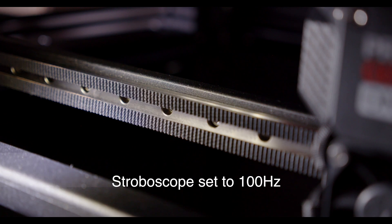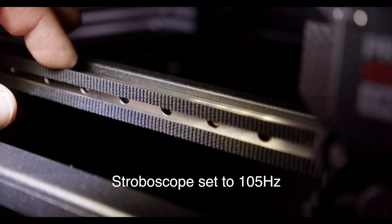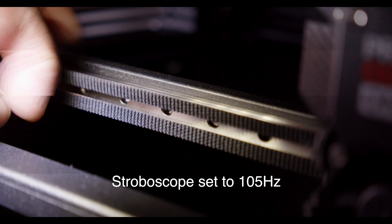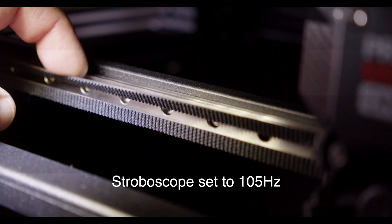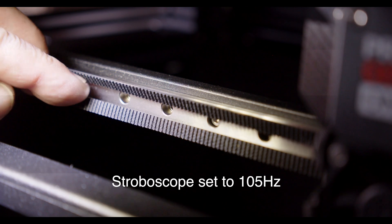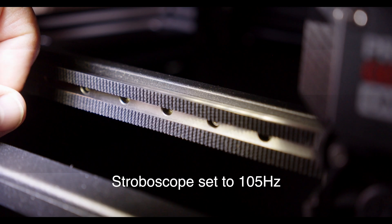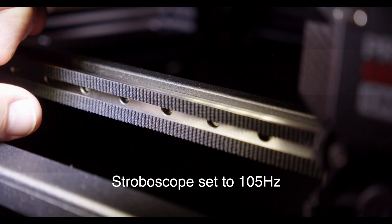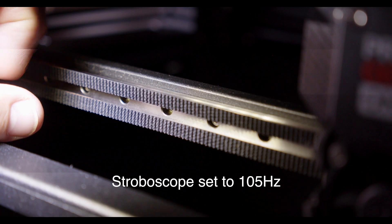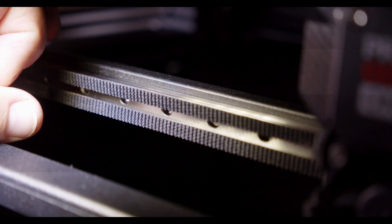So the upper belt is 105 Hz. I'm changing my lamp here to 105. Now it's not going back and forth anymore — it stands still, basically. The lower one, you see how this goes back and forth? So the frequency at 105 is where the belt stands still. It doesn't move once I strum it. So the first one has 105 Hz.